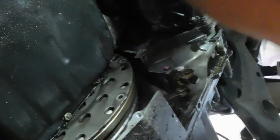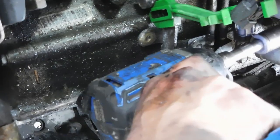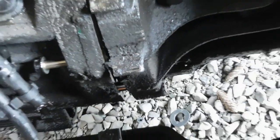Alright, and two off the T-bracket off. Making moves. So yeah, just a few bell housing bolts, and that mount right there should just come right out. I'm excited. So now they're all busted loose, we will remove what we can. Yeah, the motor just sags. Engine sags super hard. Oh yeah, it's already starting to separate. I gotta get the jack under there and support it.